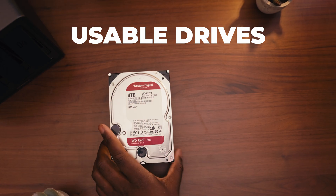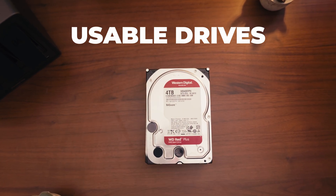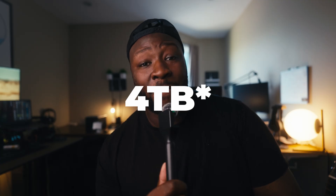The next thing we're going to go with is RAID 1. Essentially, you're going to need two drives, and the redundancy of the independent disk is going to be one of them — you're going to carbon copy one of the disks onto the other. If I had two of these 4TB drives, making it 8TB in total, when I put that into my RAID system, I'm only going to have 4TB available to me. It's not the fastest, and it's not the most storage. However, you have a carbon copy backup. Just in case things go wrong, you can port things right over, take out the bad drive, put in a new one, and you're back up and running.